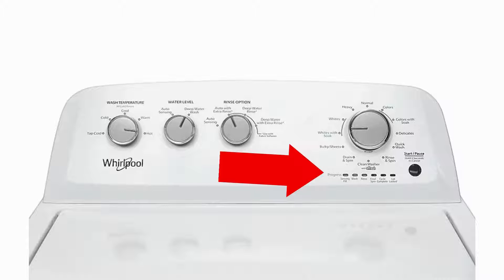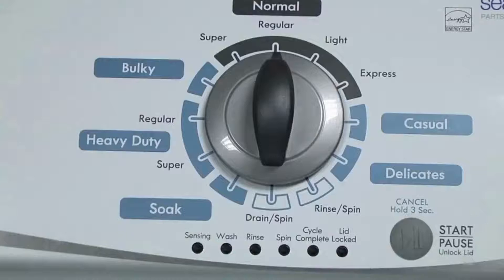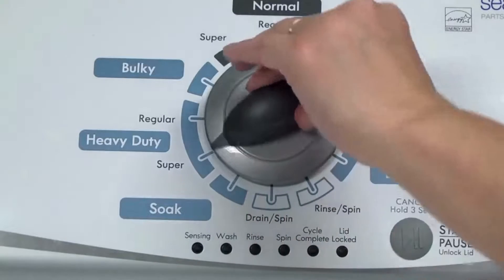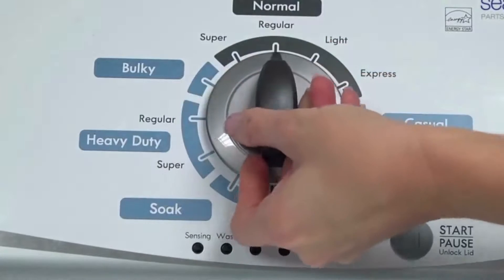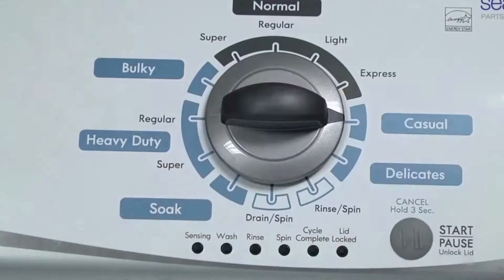This video is going to show you exactly how to do the proper steps, starting with recalibration mode. If that doesn't get your washer going, come back and do the diagnostic mode. Turn the dial one complete rotation — 360 degrees counter-clockwise — stopping with the dial pointing straight up. Now quickly, within about 6 seconds, turn the control dial 3 clicks clockwise, 1 click back, and 1 more click clockwise.